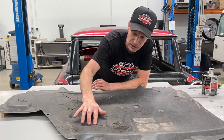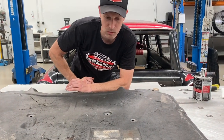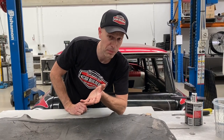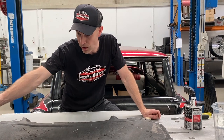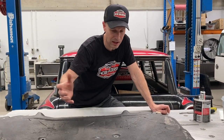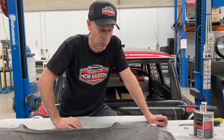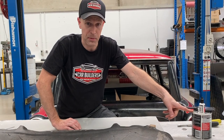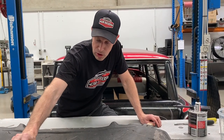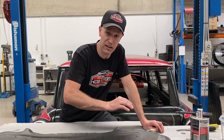There are a couple of lows here which I might just pack with off-cuts of glass strand. As I brush it on I'll determine what's going to happen. We've got a polyester resin - we're not using an epoxy, as epoxies do soften in temperature. Your engine bay may only reach low hundreds of degrees; even with a turbo, typically it's not exposed to extreme temperatures. We're going to mix this up, brush it on, wet out some areas, put some chop strand in, brush that in, let it seal and dry overnight. We'll de-nib it - knock off any highs - and then we've got a solid foundation to upholster.